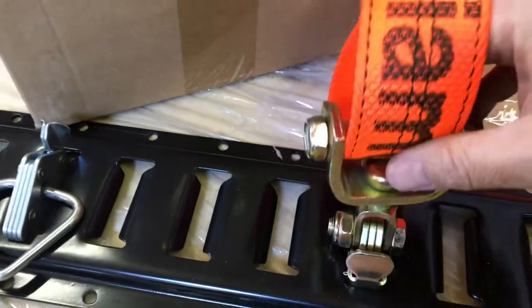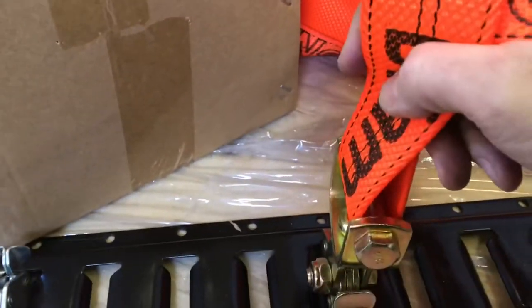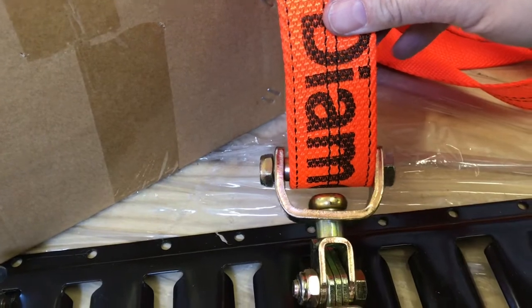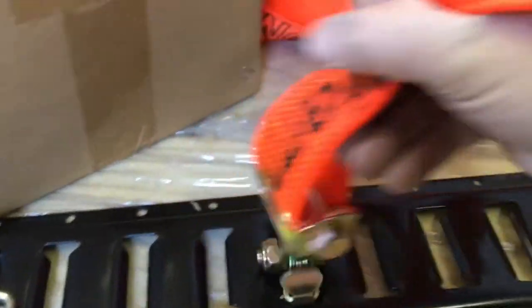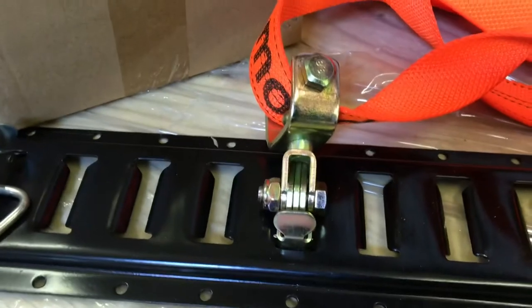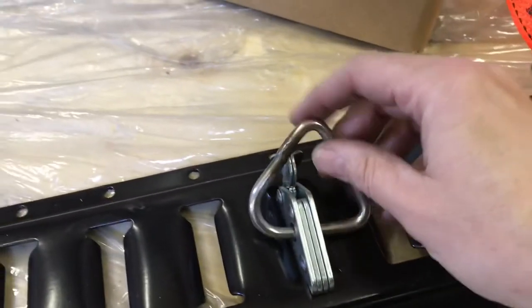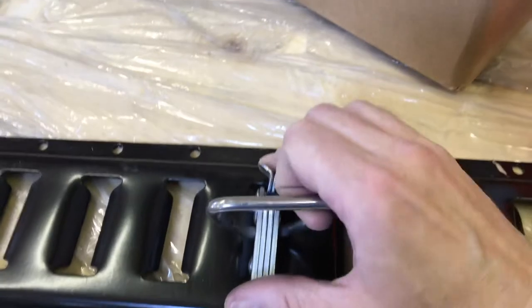For basket straps it's not quite as important to be perfectly centered. We also have what I call the double swivel — this is an e-track idler that pivots side to side and also rotates 360 degrees, so you can pull in line or off to the side. It works really well for vertical e-track. For horizontal e-track it'll work too, but it's not going to lay down as flat — it's a little limited there, which is why I prefer the low-profile roller idler for horizontal e-track. The double swivel really has its place in vertical e-track.